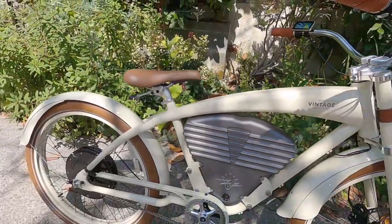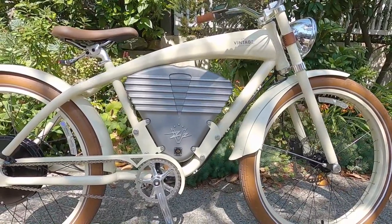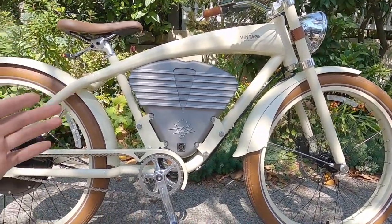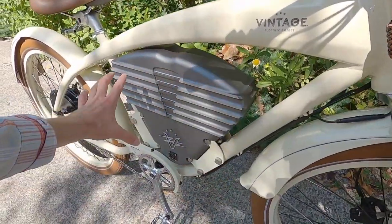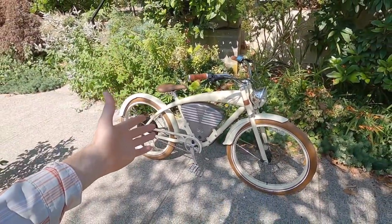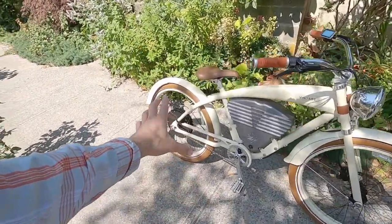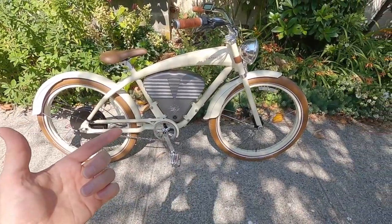And then the battery pack — this is really the star of the show right here. This is a 48 volt system; a lot of other electric bikes are just 36 volts. So 48 volt, 23 and a half amp hours, over one kilowatt hour of capacity, and that's important when you're really juicing it. The battery is 19 pounds, pretty heavy with this aluminum alloy casing, and the motor is about 10 and a half pounds. I weighed this bike back at the shop — it was at Vintage Iron and that gentleman there helped me — and it weighed 84 pounds, which surprised me. On their website it says 88, so I think they've reduced the weight with the new motor tuning and the battery design with these high energy density cells.